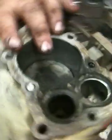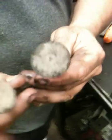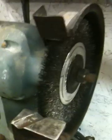You can also see on the rings here. Now that we have our two valves removed, you can see there's a lot of carbon on it, and that will reduce your compression. Sometimes you'll see that too. An intake valve, which is that one, is bigger than your exhaust valve. That's so you get better flow of air-fuel mixture going into it. Also, when you're just doing this, you can always stick it on one of these wire grinders. Don't overdo it, but just to clean off all that stuff, get it nice and shiny again. And they're made out of stainless steel, are they not? Yep, so they shouldn't usually be rusted.